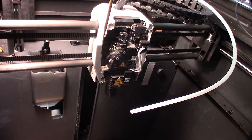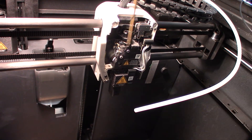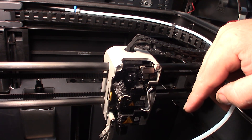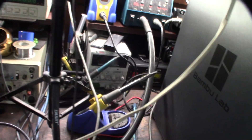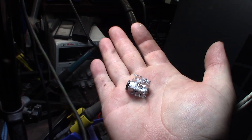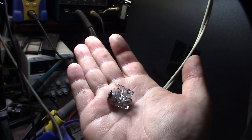I'm going to take off the cutter first, then the PCB — there's a small ribbon cable you have to be really careful with. The PCB is slowly removed. You have to be really careful with Bambu Labs printers because these ribbon cables will cut really easily and these connectors will break really easily — the tool head components are quite fragile. Here's a closer look at the inside; I'm looking for debris or something that might be causing the issue.